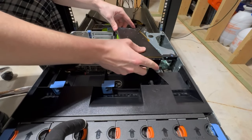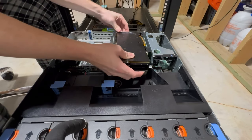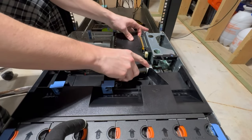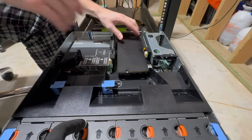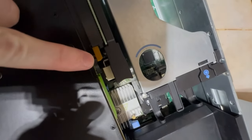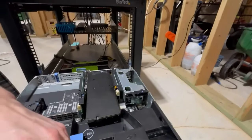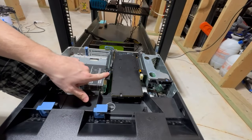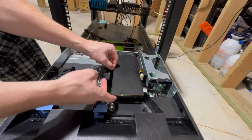Get the plastic cover situated on one end first — that makes it much easier to work with the rest of the way. Then work it in, stabilize it in the back, and push everything together. You should hear it click into place. There's a little notch that should click in, and you can press it down if you want to remove it. First one's in. Now hit the blue button to pop out the arm and put it in place to help stabilize the GPU.